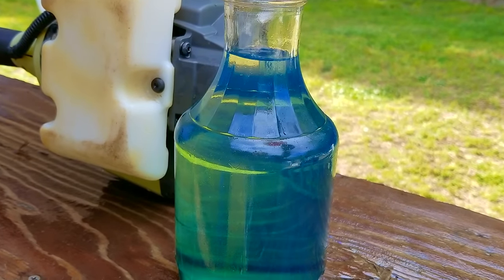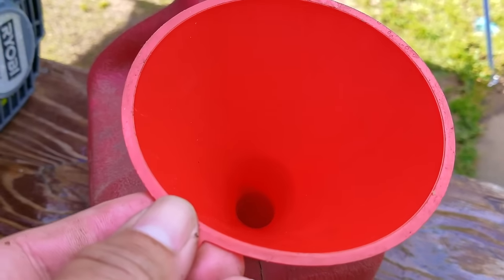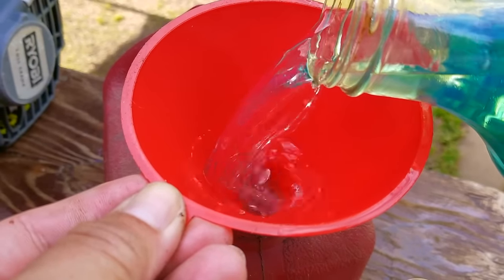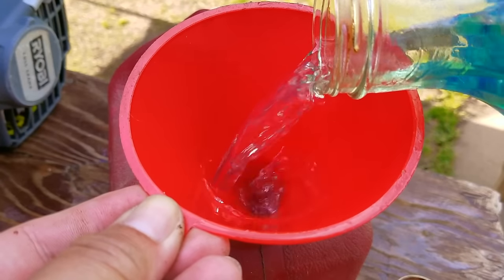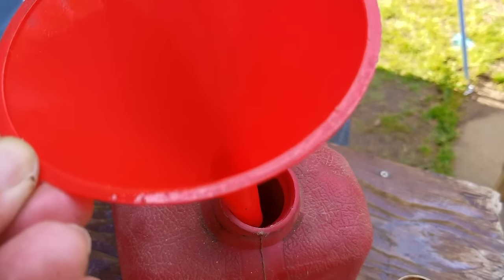After pouring 1 ounce of oil into a glass jar, followed by about 40 ounces of gasoline, I can then look at the color of the fuel to confirm that, yes, there's oil in it, and it looked just like it should. Now, some would say that doing it this way in small quantities and using a glass jar is for simpletons, but then again, I never said I was a genius.